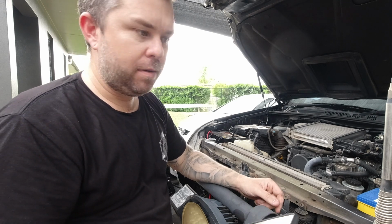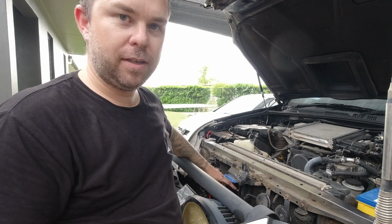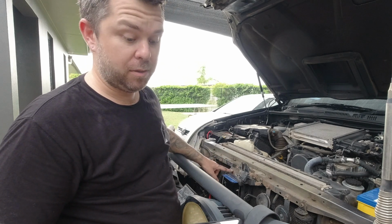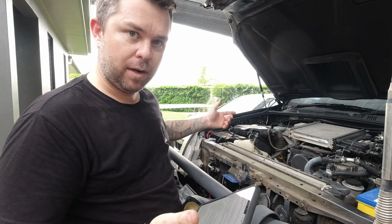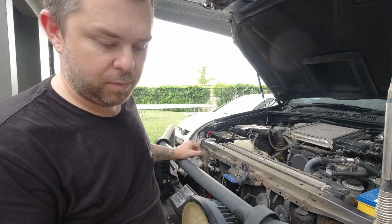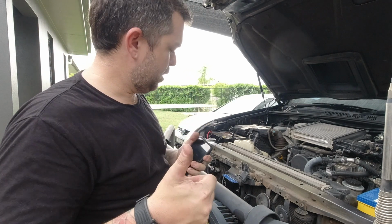And the problem you're going to have, you can get around it, but you do have to file the edges of the DC-DC charger, which probably could give you dramas if you have some sort of warranty issue. It'd be a bit of a stretch, but they'd probably get uppy about it. And to slot the holes further on the bracket will be hard because it's stainless steel, so you'd need some sort of carbide burr, which not everyone has laying around, but most people have a file, so she's just scraped in there and managed to pinch that down, but just be careful of that. But other than that, mint.